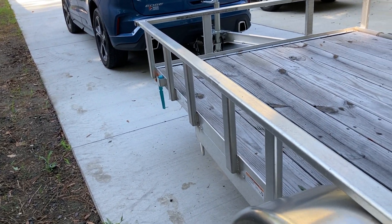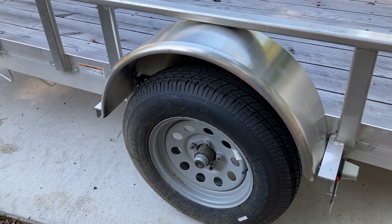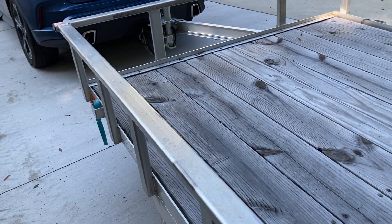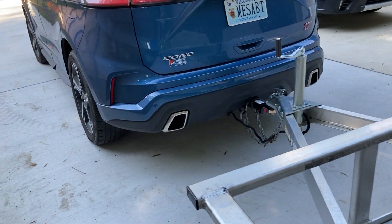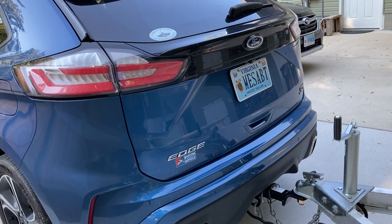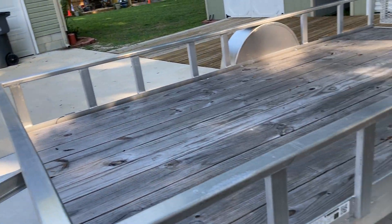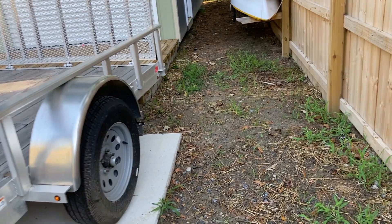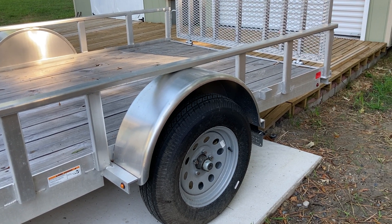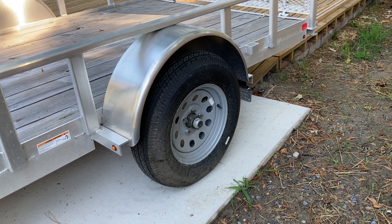We've checked from bow to stern. Things you should always keep an eye on are tire pressures — appropriate for the load you're hauling — and bearings: make sure they're greased and you don't see grease flinging out. Also watch for a flat trailer tire, especially going long distances at highway speeds carrying weight approaching the max, because under-inflated tires cause the sidewall to flex a lot.